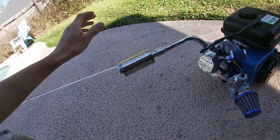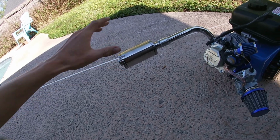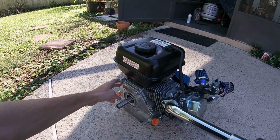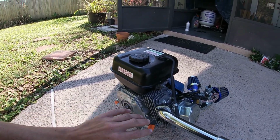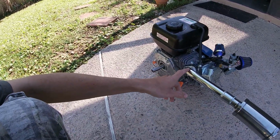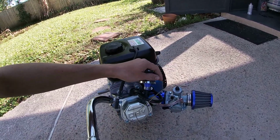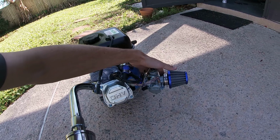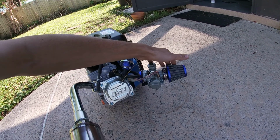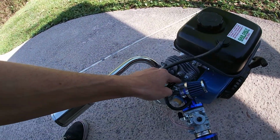I also changed out the muffler on it just to see if we get a little bit different sound or even a little bit better noise suppression here. We'll see what happens. So in all, we took the crankcase apart, got the governor out, deleted out the oil sensor. We changed out the muffler to a header pipe. Added a crankcase breather, so deleted EGR. Added a Mikuni clone carb, which I'm still questionable about. Is going to get replaced with an actual Mikuni whenever I can.